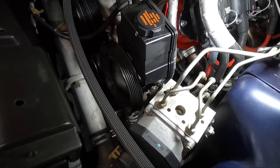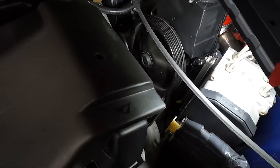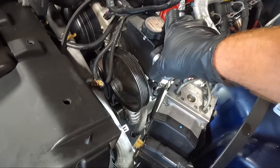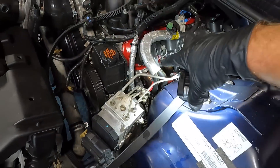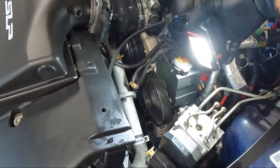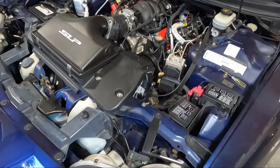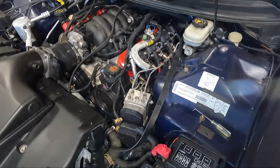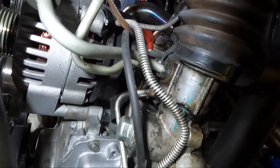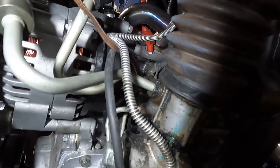There's only one wire in the plug so it's easy to pull, but especially when they get some age on them, they can be fragile. This one is low mileage but was subject to a lot of heat from the turbo. I fought and fought and couldn't get it with a pick, so I unplugged the temperature sensor from the side of the head, unhooked the throttle body and mass airflow connections to give it some additional slack. We also need to undo the 13mm power line on the back of the alternator.